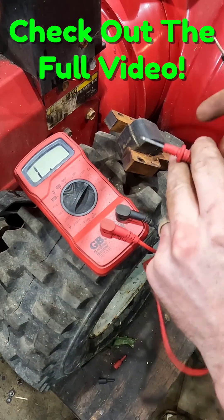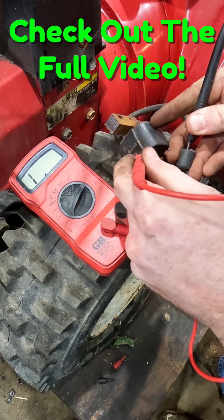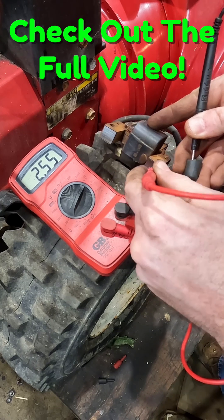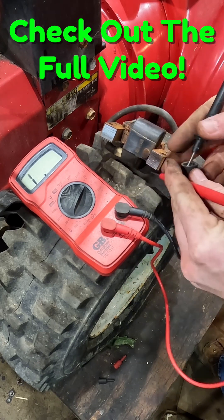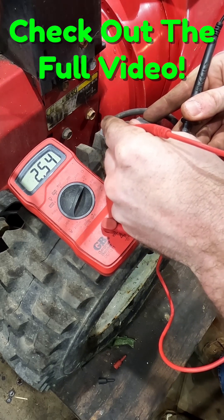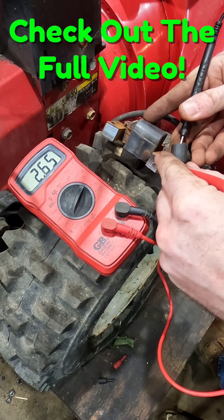For the next test, we take it up to 20k. We're going to test the lead back to one of our armature coils, and that's supposed to read somewhere between 2,500 and 5,000 ohms. We're right at 25.4, then it went really low, then more in the middle. I'm getting some inconsistent readings here — we had a 12, that was really high. I'm kind of wondering if it's not our coil.